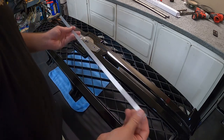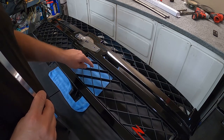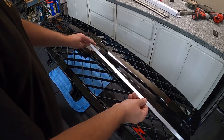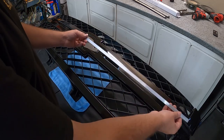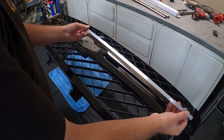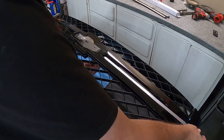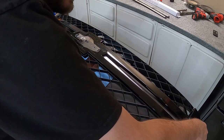In my case the installation is going to be a little different since this is an 11-to-13-style grille with an X-pattern instead of a straight pattern. The hole placement means if I run the bracket to that hole, we're a bit short on length and it would block the emblem. So I'm going to drill a small hole here to mount it, and bend this end down to contour to that shape, then run a screw from the back side to hold it in place. You can pretty much see how it'll sit — we just bend it right there.